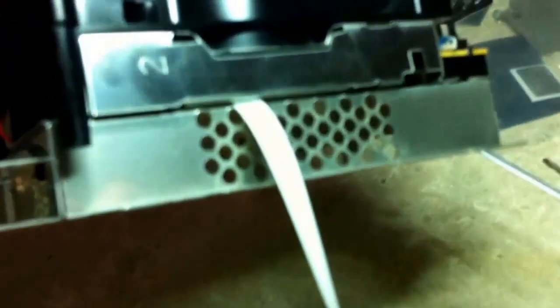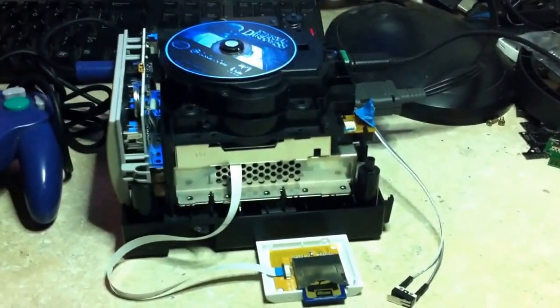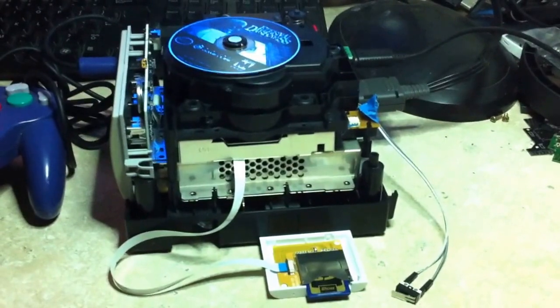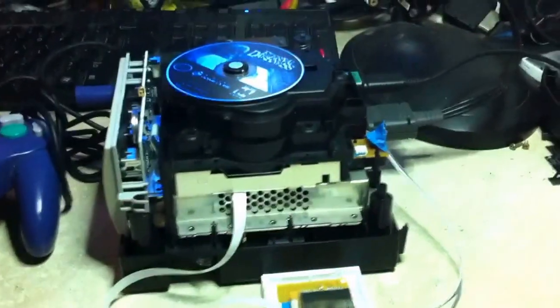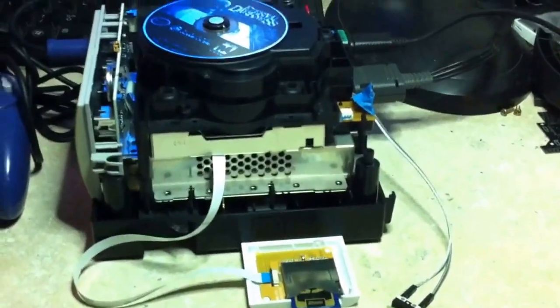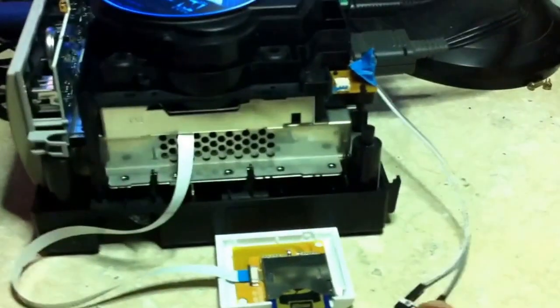The cage has now been installed and it's shut tightly with the card slot cable hanging out the side, which will be mounted within the GameCube — time to plug this in and see what happens. I now have the Mega Drive V4 completely installed and assembled onto the GameCube console. The Mega Drive V4 with the WASP Fusion fits within the space between the top of this cage and the gap to the DVD drive board.